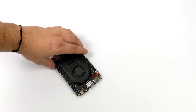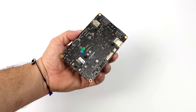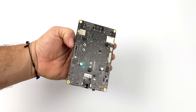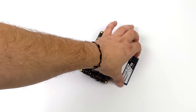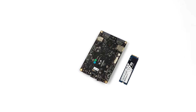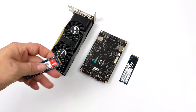Setup on these boards is really easy. If you pick one up pre-installed with Windows, all you need to do is plug it in — it'll run from that 64GB eMMC storage built in. But 64 gigabytes isn't a lot nowadays, especially with Windows, so I want to add more storage. I can go with an NVMe SSD or a regular SATA M.2 SSD, and I'll be using the NVMe slot for an external GPU in my next video.